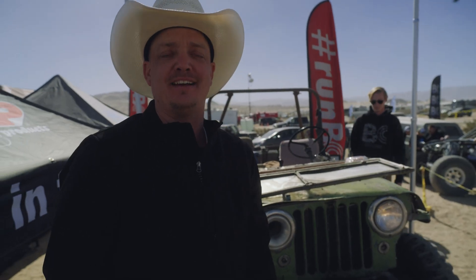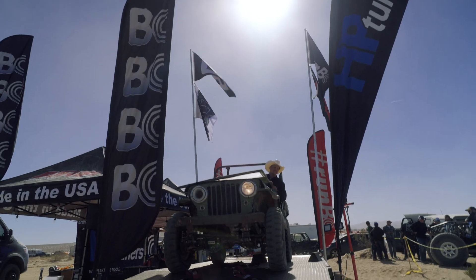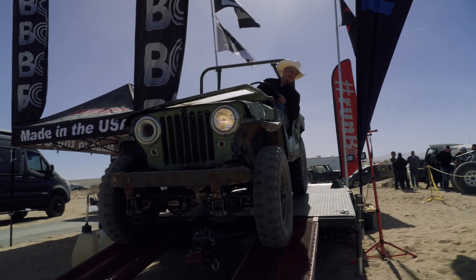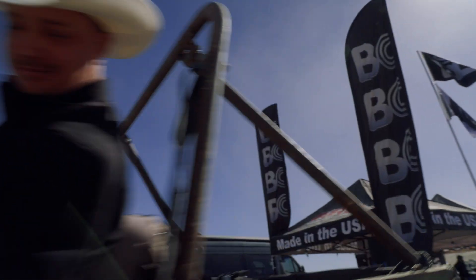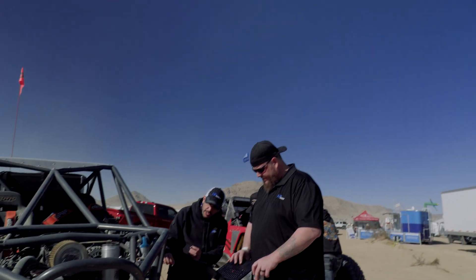The run went pretty good — more power than anyone thought. We pulled the air filter and it was full of oil from a little rollover, so we went from 78 up to 82 horsepower after clearing that out.